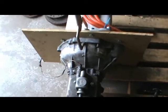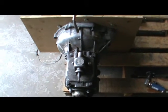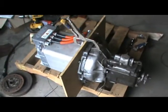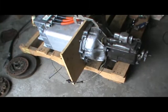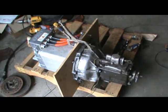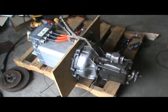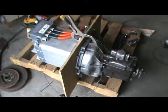It's lined up. We're going to get a flashlight, look down through the through shaft of the motor and make sure that the input shaft is dead in the middle. We got to do some measuring. The flywheel high tensile aluminum block for us cutting the flywheel will be in today, I think. I don't know that we're going to attempt that here ourselves. The flywheel is going to have to be made with a bore at the back to take the bearing that this input shaft goes into.